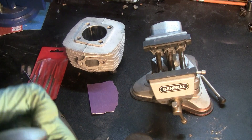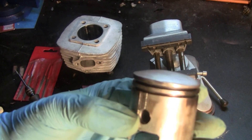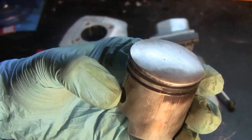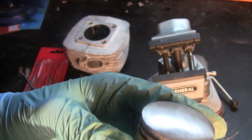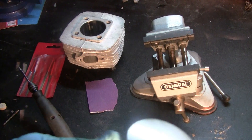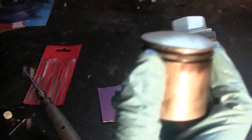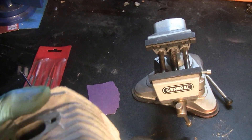As an alternative to porting the exhaust, you can use a piston and reduce the chamfer on the side by removing small amounts — I mean small, like an eighth of an inch or even less. This achieves the same effect as raising the exhaust port. The only difference is that cylinders cost around $25 while pistons cost about $10, so if you make any mistakes while experimenting, pistons are more disposable and cost-effective.